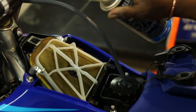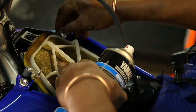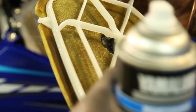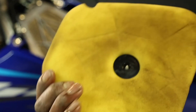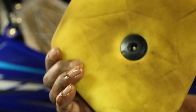So when we pull out the air filter, the dust doesn't fly and fall on wrong places. You can see the concentration of oil because the bike is new and most of the oil ran backwards. But if you look, this air filter was oiled from the factory, and you can see underneath the dust has gone through the air filter, which is not good for the motor.